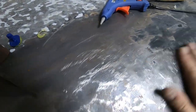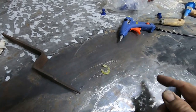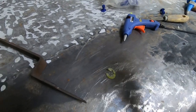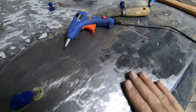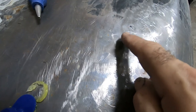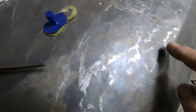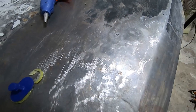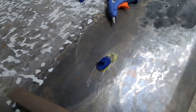It's working — it's actually working! I changed the glue. I had this other glue in a drawer that happens to be the same rod size, and it's a lot stronger than the glue that came with the PDR kit. The PDR glue is designed for panels with paint on, meant to be gentle, but we need something more aggressive on this older, thicker panel. It's all coming out — the low spots are pulling up. One area that was really low came out with one bonk. Anything that's low we'll pop up, and if it comes too high we'll slap it back down.